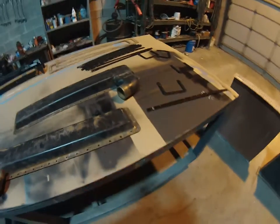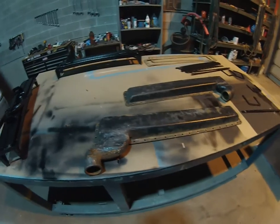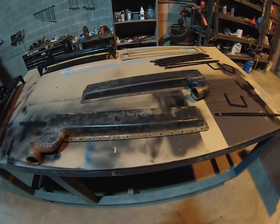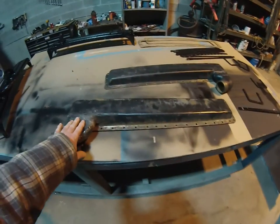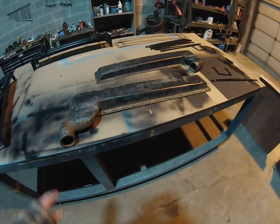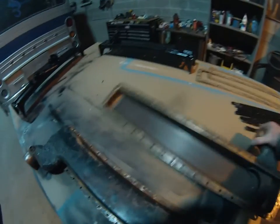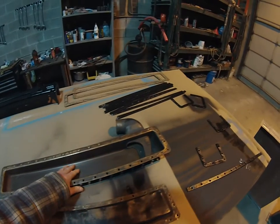The only place that this radiator leaked was out of the bottom outlet around this. And as you can see, the previous owner used some JB Weld or something to do a repair. I initially searched for new tanks because I was concerned about this. And those are basically not attainable. So I was going to make this bottom tank out of stainless. This is the top tank. Now, these tanks are made out of copper. This is a formed copper sheet. So these things are in perfect condition.